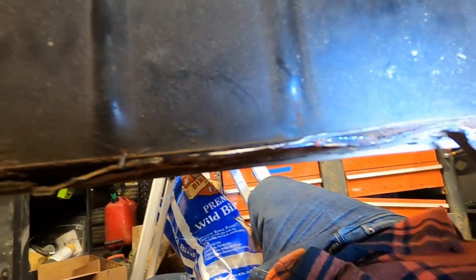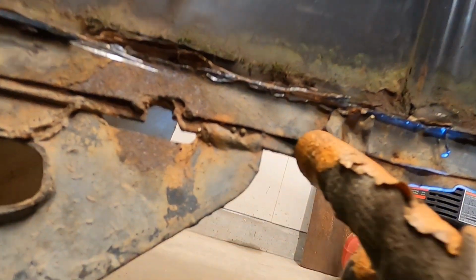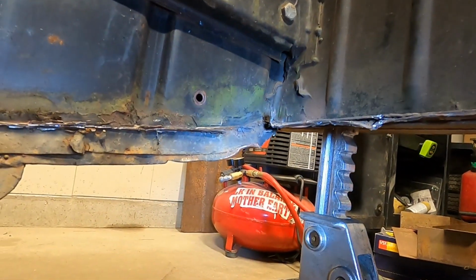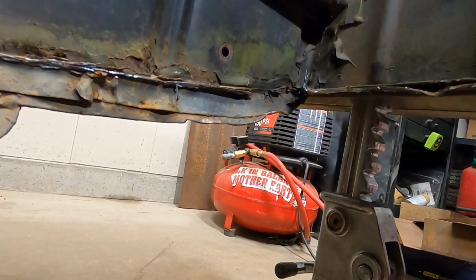I'm finding that I have the same spot weld stuff around the rear apron, so I can start to pry that up a little bit and then take it off from there. And then along the side here, I've also got pieces like here where I can pry up and cut that and then pull it open again, and it makes it a lot easier than just trying to pull piece by piece. So working on that, and I wish I had a lift. If someone wants to give me $2,000, go for it, but I'm gonna struggle under here until it's done.